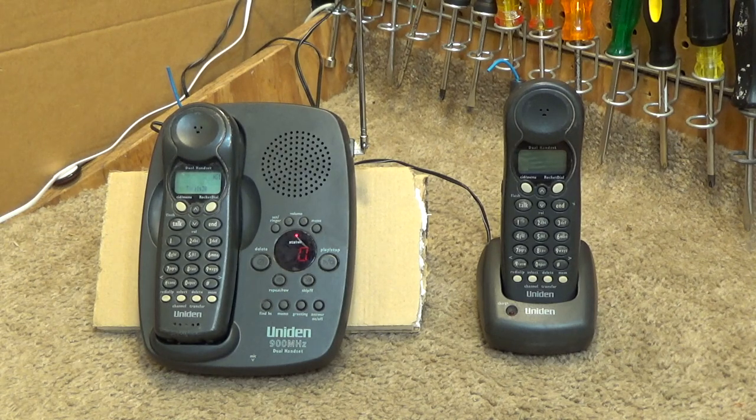I've been buying cordless phones for many, many years, and out of a sample of hundreds of phones, up until 3 or 4 months ago, I can think of only one or two cases where I saw a corroded battery, and it's usually some cheap knockoff one. This time, and for the last several months, I've received probably 5 or 10 different phones with decent batteries in them that were corroded, several of which have corroded to the point where it went all the way down the battery contacts and into the board and ruined some of the traces.